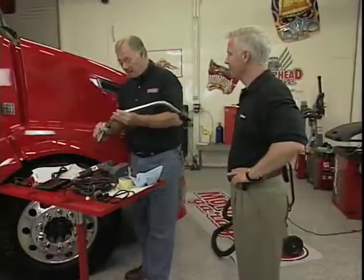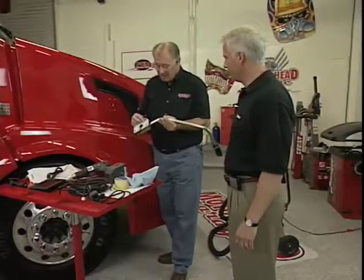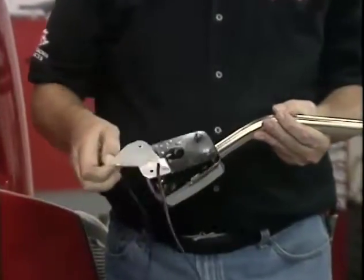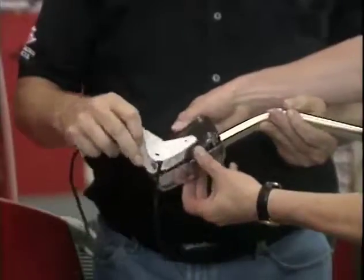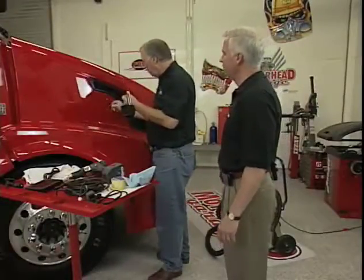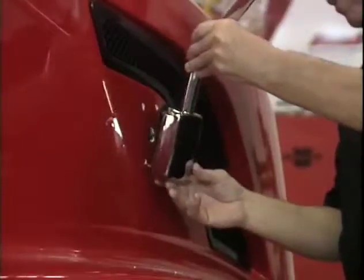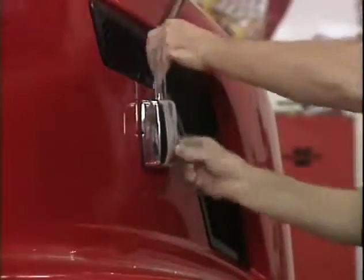The next step is we're going to take our camera and mount it. The unit comes with a gasket — you just peel that off. We'll slide this in, put our cable in here, and go ahead and mount that right up there. Piece of cake. Now I've got to raise the hood to get the nuts behind here. Meanwhile, here's our monitor on its stand. You want to get it close to the driver so he can really see and take full advantage of the AeroCam. I'll mark the four holes, drill them, and get this done.